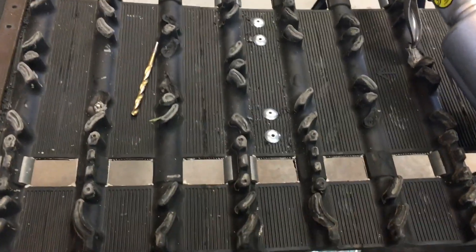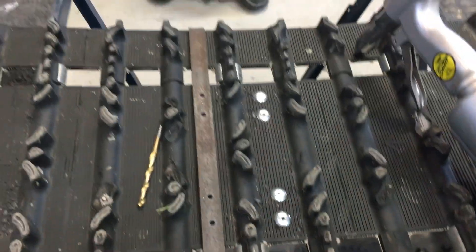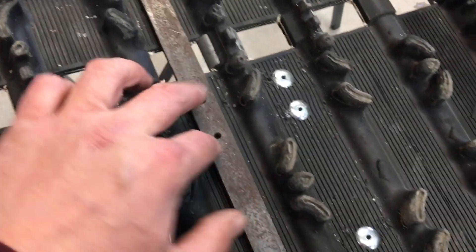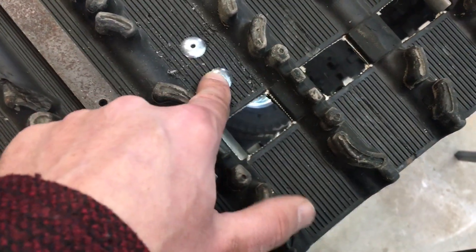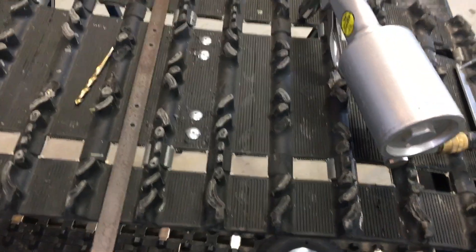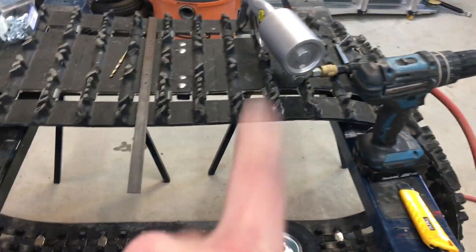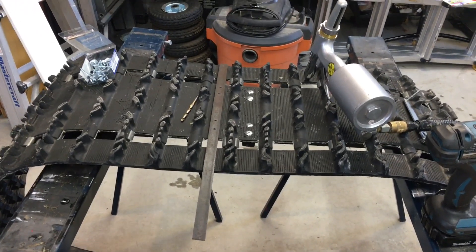Here's what I've come up with — it's very straightforward. Just a piece of flat bar that you lay between the rows of lugs, line up one edge with the track, and use a drill bit to go drill, drill, drill, drill. Then you line up the tab from underneath, put the rivets in, and use the rivet gun to fasten the tabs in place. I'll get all the holes drilled and then go back and rivet all the way across. Lots of repetitive work, but let's get at it.